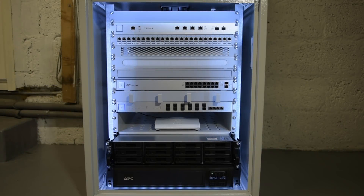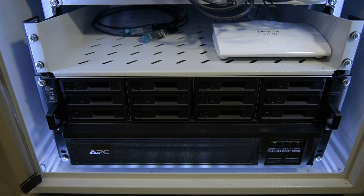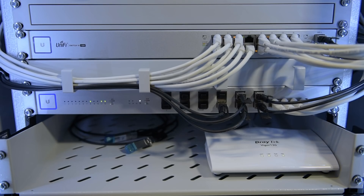This is what the reordered cabinet looked like before any of the cable work was completed. The only additions were the cable management slot with brushes fitted and one new ventilated blanking panel. During the planning process I tried to space out the network equipment to avoid any possible temperature problems. The cabinet was almost complete by this stage, but you might notice the loose ends of the SFP+ direct attached copper, as I was still waiting for the 10-Gig network card from Synology. Even with many patch panels now directed towards the Switch XG, the original 1-Gig 16-port is still almost at full capacity.